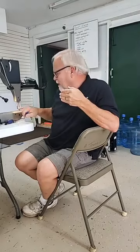When you go to a really small needle like a 3.0, and I have it set with a 4, I'm going to have more of a gap between my hook point and the needle when the hook goes past, which could cause skip stitches. What aggravates it even worse, with a small needle like that, we've created a gap by putting the small needle in, but remember, we're moving the machine also while the needle's in the fabric, and the needle is deflecting. It deflects into the hook, it deflects away from the hook. It's not going to stay straight.